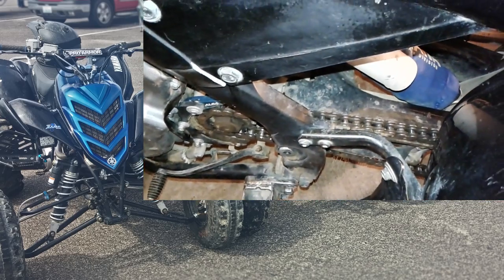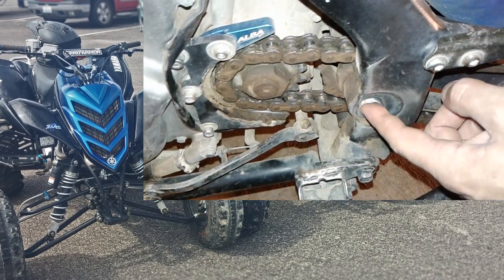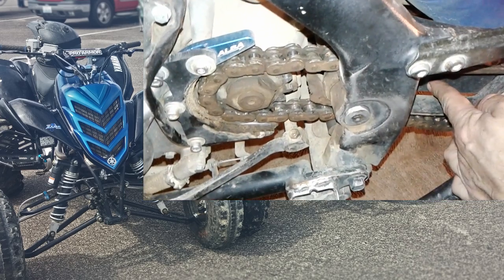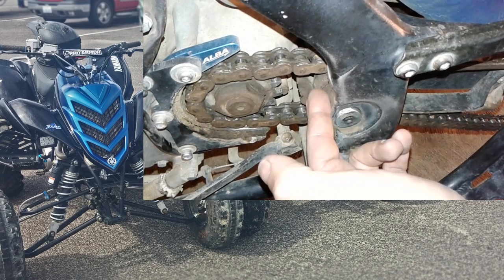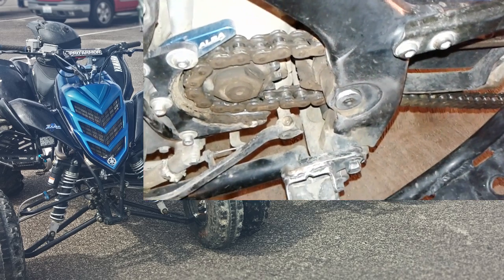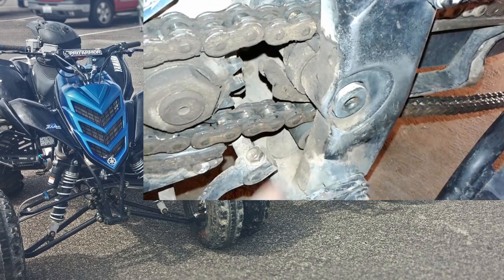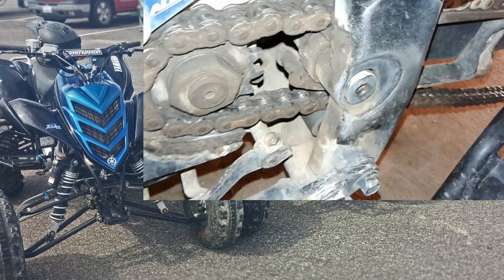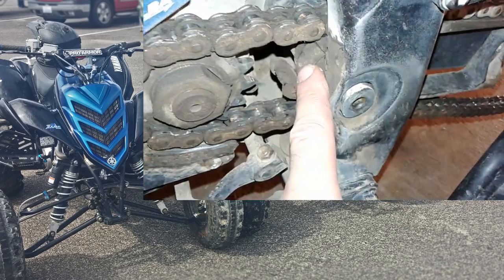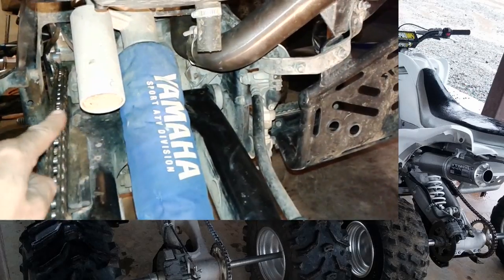This is the Vetos Performance Racing swing arm bearing kit for the front swing arm bearing, just behind the sprocket. There's a bolt that goes all the way through the swing arm — it holds your swing arm to the frame so it can pivot like a hinge. When those bearings go bad, you can rock the quad side to side. As the needle bearings fall out you'll see slop, and as you rock your body side to side on the pegs you'll really feel it.